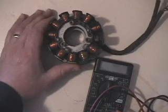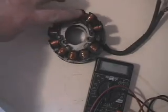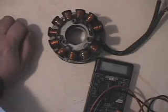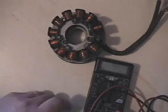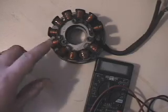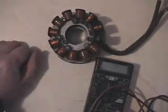There are basically two sides to this stator. There's the power side — we've got two, four, six coils here with larger gauge wire, and that powers your hand warmers, lights, gauges, and so forth. The other side of the stator is your ignition. We've got five coils here for your ignition.